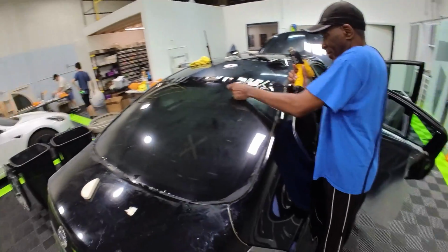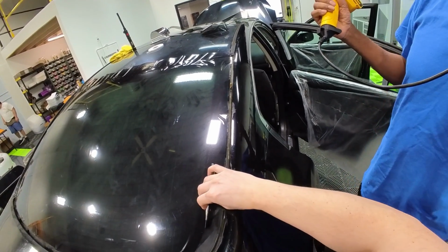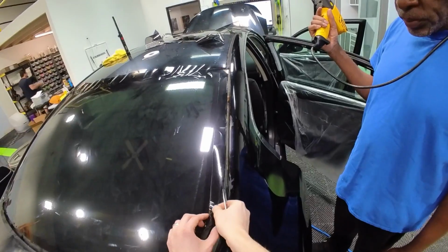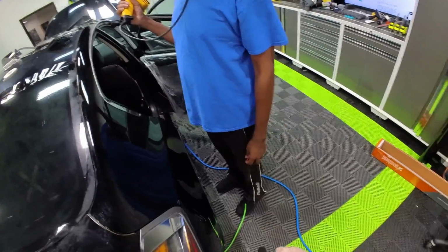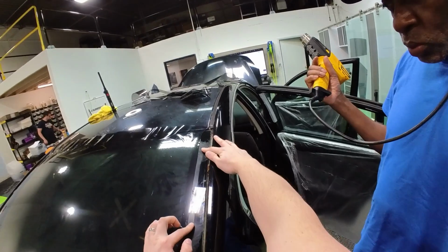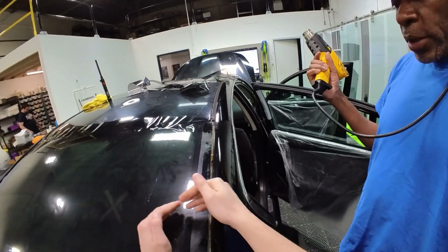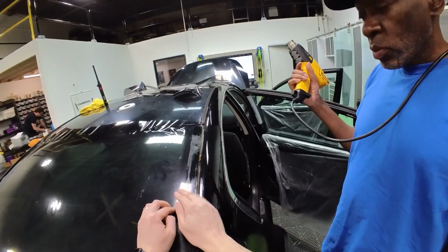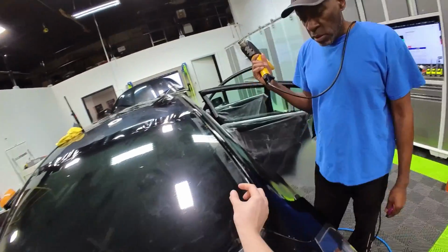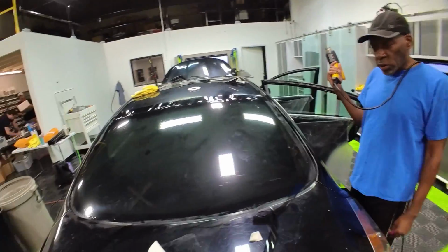Okay. One thing that will maybe help a little bit more next time, just to keep in mind, is if we trim this up a little bit farther. So we're over the side maybe just an inch or so, not closer. Because what happens is if your glass is really wide past the border and we smooth it down and flatten it here, we have to anchor it on the very side of the film. So it's also taking this curve and pushing it up into here, so this all becomes part of our shrink. But if I trim some of that off, because we don't need to worry about this, then it's going to be a little bit less aggressive up here. Okay. So your sides can be 1/2 inch to 1 inch. That's totally fine. And the top and bottom are totally fine with how you set it up. But there you go.